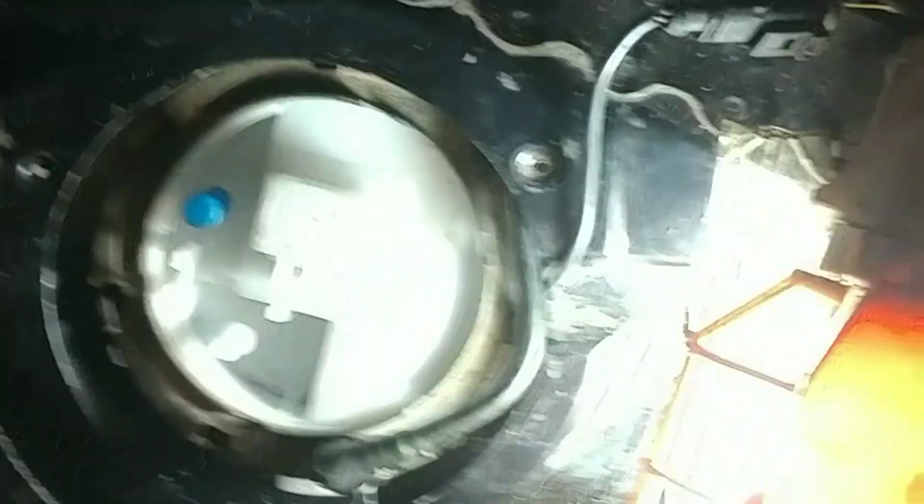Gotta be careful with these hoses right here. So I get my light to hold that back. Alright, got the O-ring in. Got the fuel pump in there. Don't got this locked in yet. I will, but the lines here, we'll just push down on there and lock. Make sure they lock, because if not, they'll blow the fuel back.